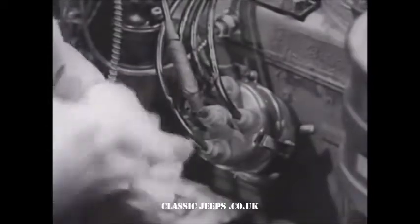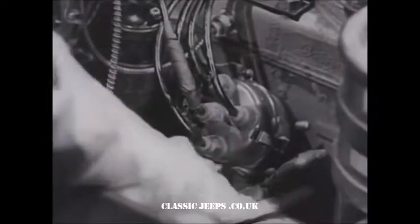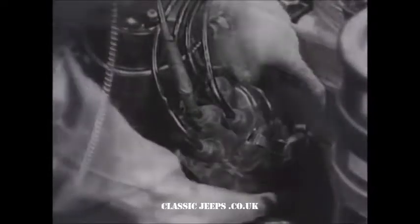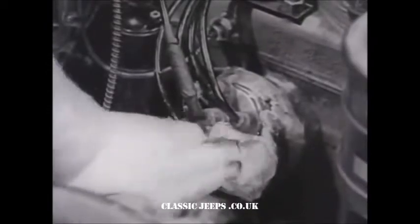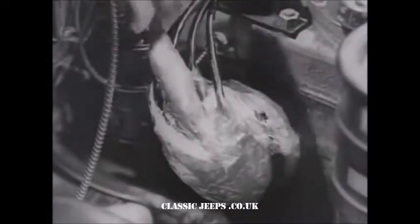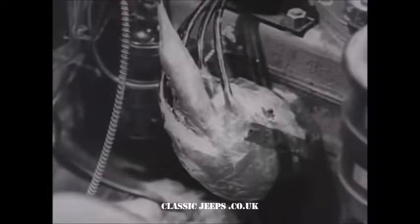When processing the distributor, exceptional care must be taken. Unless it's perfectly sealed, the engine will fail when the vehicle enters the water. It must be noted that all surfaces are well rounded, with no irregularities or rough surfaces that may tend to pull the compound off when the vehicle is moving through the water. The suppressor on the lead between the coil and distributor is finally covered over with AWC. Friction tape is placed over the breather and left unsealed until just before the landing operation.